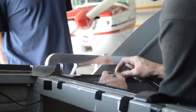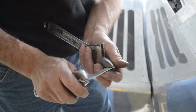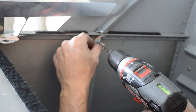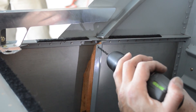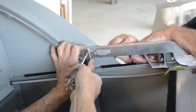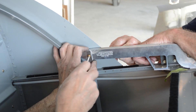We've included an aft support bar as well. We recommend this placement and a few screws for this bar. You may find you need to do a little bending to get the support bars to fit appropriately. When you're drilling these holes, be extremely careful not to drill through the skin of the airplane — we backed the holes with a block of wood to keep an errant drill bit from damaging anything. Now the top screw here can be a little tricky. If it's giving you trouble, you can always take the S-Track off to install the top screw first. We chose instead to awkwardly poke the nut into place with a screwdriver and hope for the best. Either way works in the end.